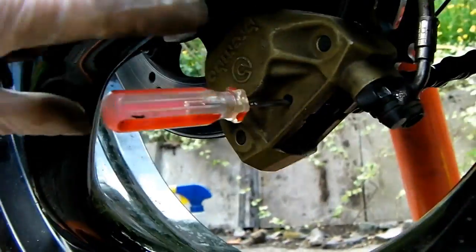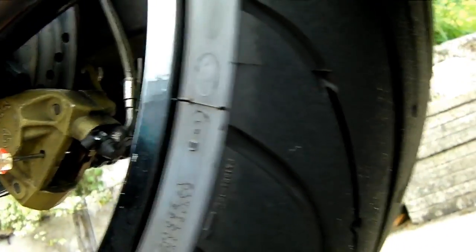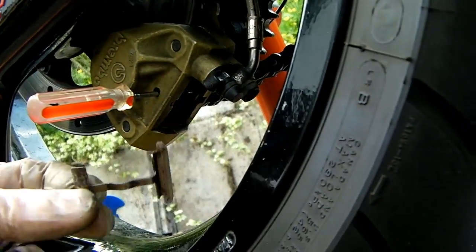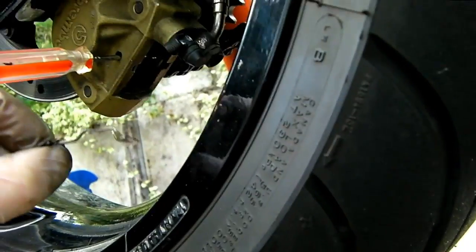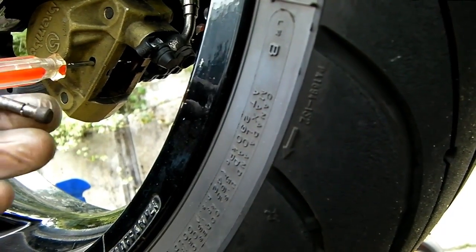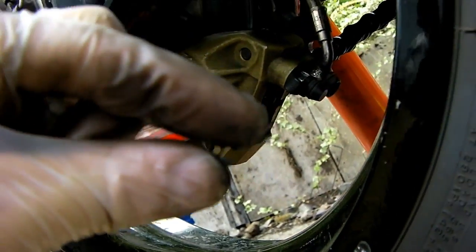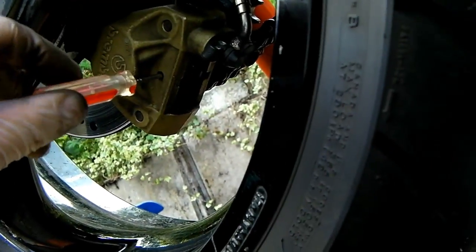The caliper's bolted back on and in place — it sits there upside down as you can see. This screwdriver is currently holding the greased pads in place; both can move freely. The retaining spring fits this way up — you can see the hump in the middle where the retaining pin passes through. It's got a split pin on one side and a little e-clip which clips into the groove at the end as it protrudes from the other side.